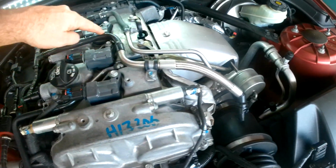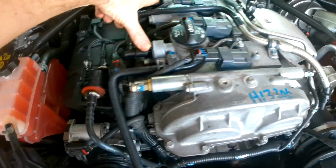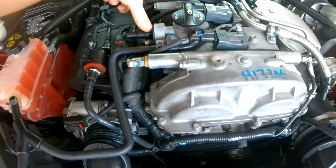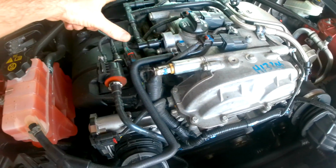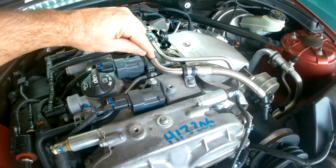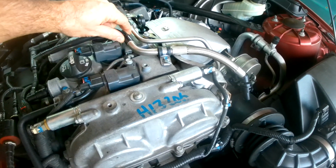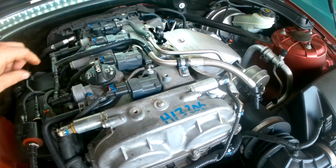It goes along here, then it branches off, splits off here, goes into the intake manifold or cylinder head valve cover in a couple places. The key places where it does like to break are going to be first along this line here. You may see a crack on top, on the side, or on the bottom. Oftentimes that hose will get really loose right there.